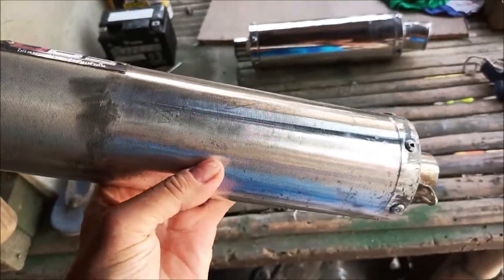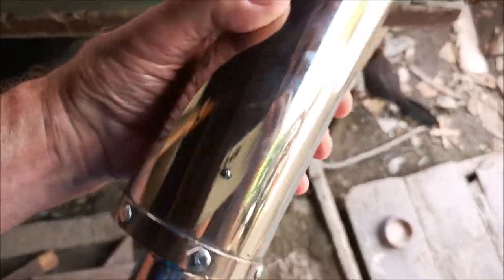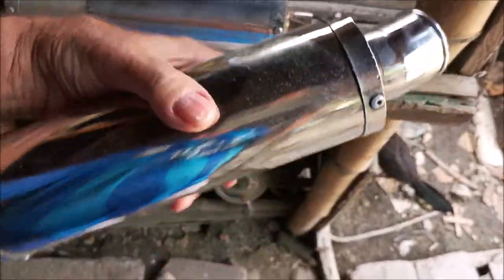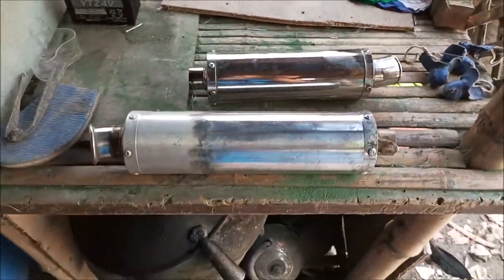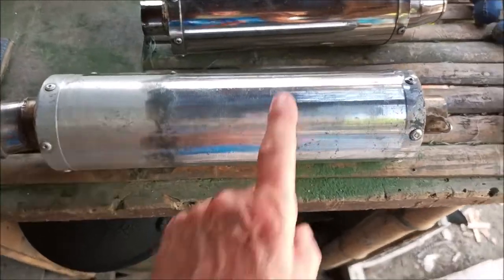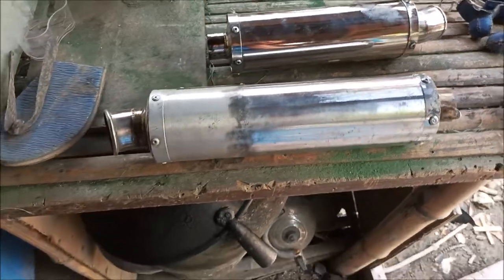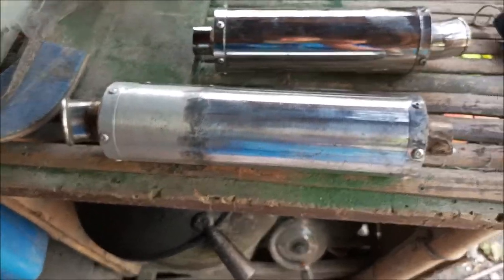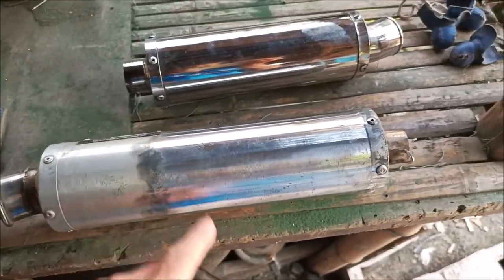This is, again, aluminum here, so buffing that, it comes out not as chromey looking as the stainless steel does. Stainless steel just looks beautiful. It's all like chrome, but it's not chrome. It's stainless steel, so it's not a plating. It's a solid piece of stainless steel. So anyway, you can see, if you just buff this with a little buffing wheel on an angle grinder with the buffing compound, I'm using the green buffing compound, and that does this. So I've got to finish this, and then we're 100% done.